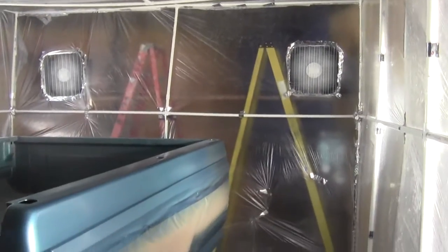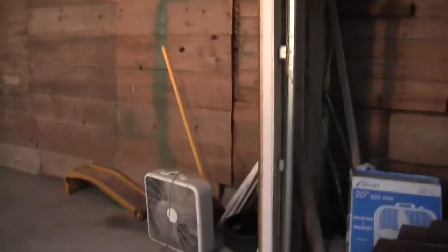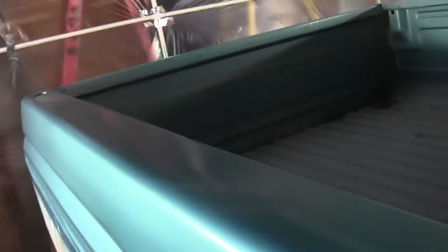It's gonna look a lot better once we pull the tape and paper off. I had the fans going up here and realized between coats that I didn't have the filters on the back of the fans. I didn't notice it on the white, but on the green I noticed there was some dust sitting on top of the first round of base coat. So I went in and tacked it off - I don't think very much actually got in the paint. I just got done spraying a few minutes ago and you can already tack it.